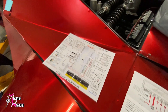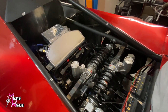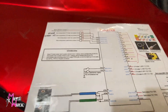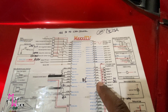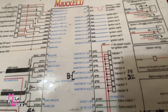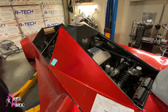The point is, at least with this system — I don't know how Motec and Haltech and everyone else works — but with this system you figure out what has to be managed on your engine block, what features need to be read. If I wanted to run a boost controller, I have some pre-wiring done with the harness. I have a boost solenoid output and some wiring done if I ever want to add boost control. I can go into the ECU and configure one of these extra outputs — I'm only running four injectors, so I can use one of the injector outputs and turn it into an output for the boost control, the increase/decrease valve for your boost controller. Anything you want to do to a race car, this system will allow it. The only limit is what do you want to do — how do you want to use this car?